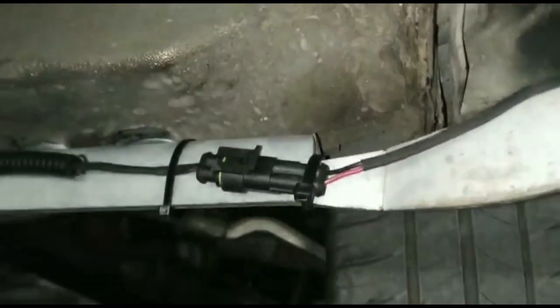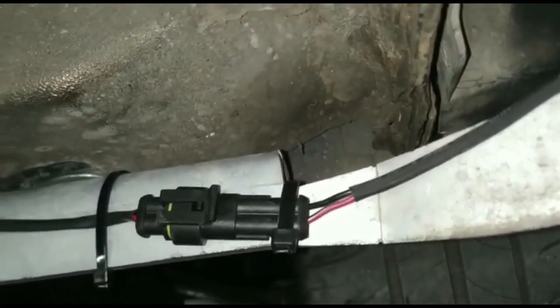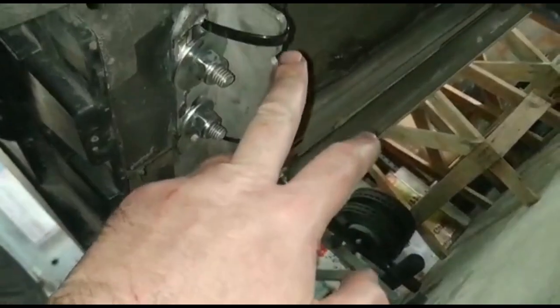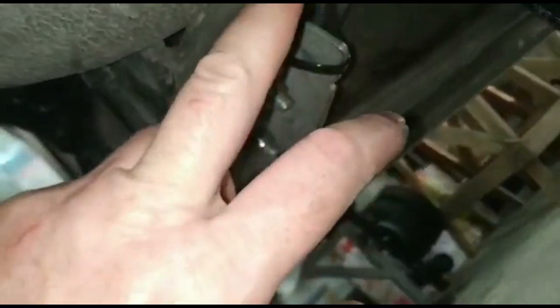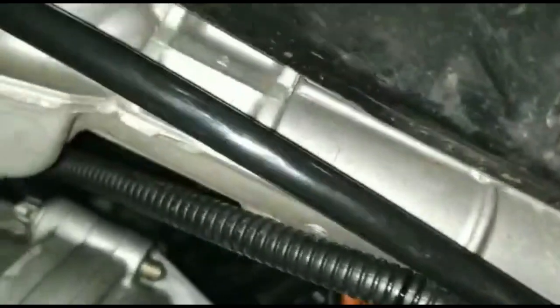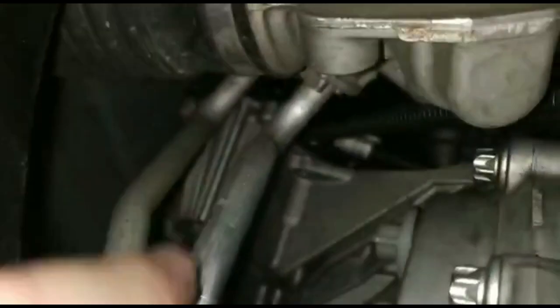I routed the wires here in the guide channel. Passing, passing, passing. I added this to prevent the tape from coming out of the guides. Then I used this type of connector — plug and play — so that if I ever need to remove the step board for any reason, I just disconnect these and everything is easier. I'm literally under the car. This is the side I showed earlier — this is the step board bracket. I ran the corrugated conduit around this side, near the steering box. Here I made a junction point between the two LEDs, right and left, because from here it goes up to that point where I removed the plug from above.